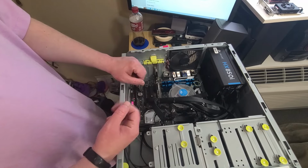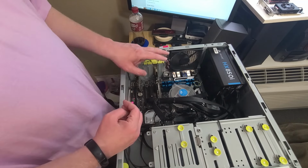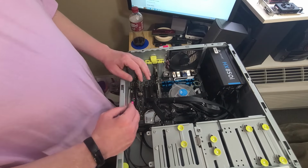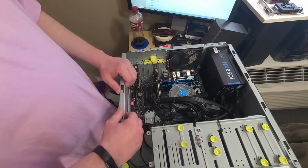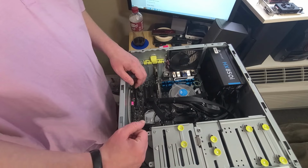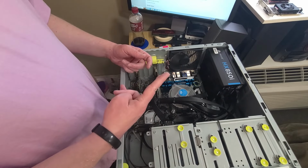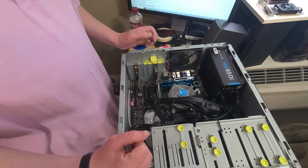I don't know if we're running dual channel, but since they're 4 gigs, they're going to be two different sets. So I do have a 4 gig and an 8 gig. Terrible matching, but if it works, I'm happy with that because then it's going to be 20 gigs and probably not going to use more than 16 off of this system. I think that's what I'm going to do. We'll put the two sticks of RAM that I have, like I said, one's a 4 gig, one's an 8 gig, and pair it with these two 4 gig sticks so we get 20 gigs out of the system.